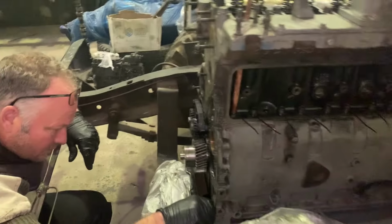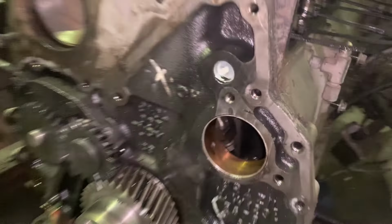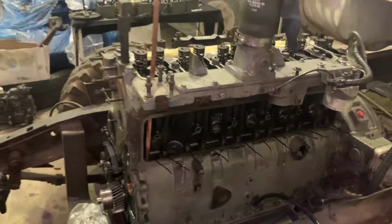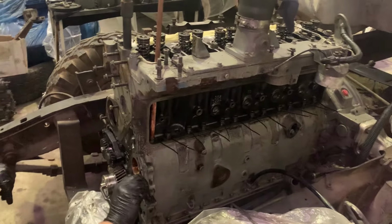So yeah, that's out now. Arno's busy cleaning up the gasket seals there. I'm gonna take the sump off still. Got the cam out, P-pump off, lifters all in place, got the dowel rod going. And then next video you'll see, we'll paint her and then start assembling her, and then there'll be the fire up video. But that basically wraps up the disassembly video, and then we'll do a reassembly video.